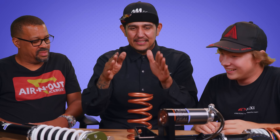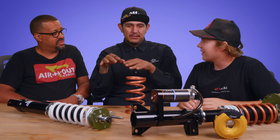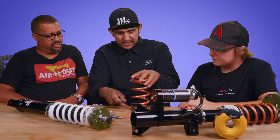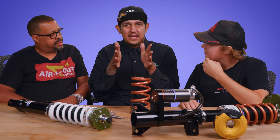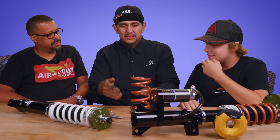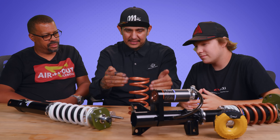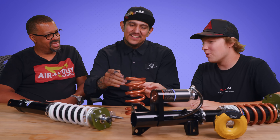My idea was to get it a little bit lower so I could see the stands. Traditionally if you cut a spring it doesn't stay flat — it'll be on that little tip. So what you normally do is burn it so it comes back down, then shave it to get a flat spot. In my Miata, I didn't have that space, so I figured if I burn this side and this side, it'll pancake down. I couldn't reach it, so I hit this side and then tried to hit the other side, but I hit more on one side — so the spring started going like this.